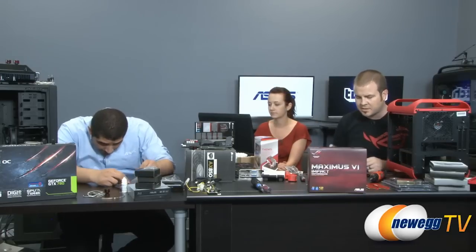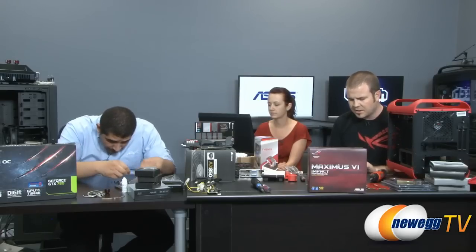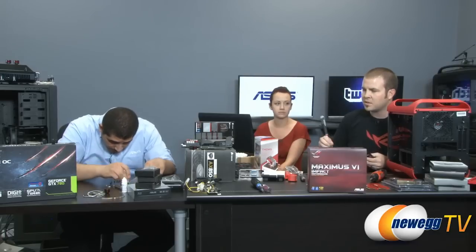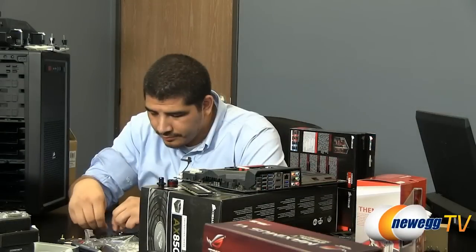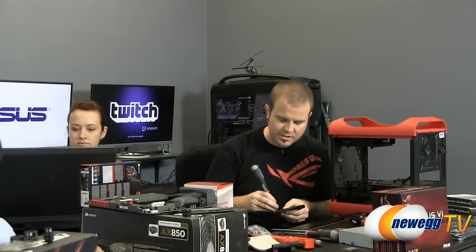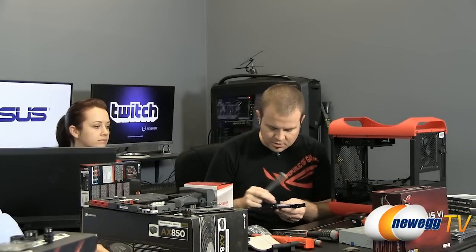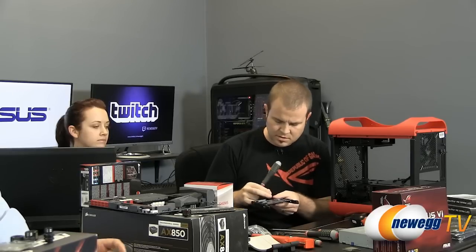I think it also pays to pay attention to the use case for the fan. Buying pressure optimized fans for radiators, and airflow optimized fans for your air intakes and outtakes, can also make a huge difference. A lot of cases might be fairly inexpensive and still come with two or three fans. But I've found that inexpensive cases, while totally functional for a build, are where you see them cutting costs, often with the fans that are included. So swapping out the fans included by default in cases can often be a great way to reduce the amount of noise the system generates, and also improve your airflow and reduce your temperatures.